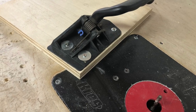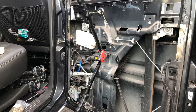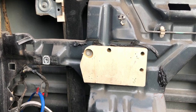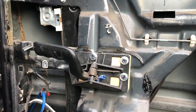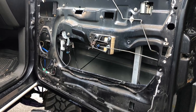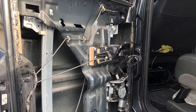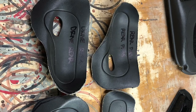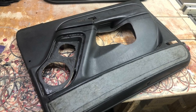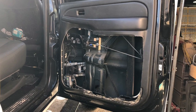The first thing I wanted to do with these door panels is get this handle raised up off the factory height about an inch and a half to two inches — I was able to get an inch. What I did was put some nutserts in the door, secured a wood panel, and secured the handle to that panel. I also had to make some new door mechanism pulls; the metal parts had to be replaced really just for speaker clearance, to make sure we had enough magnet clearance in the back.